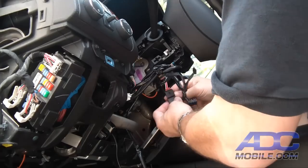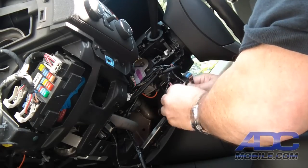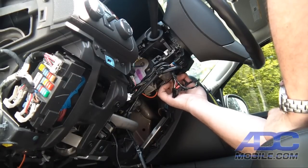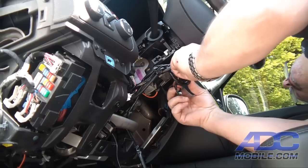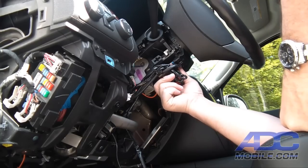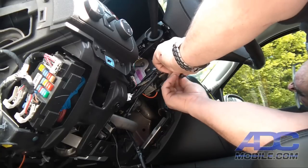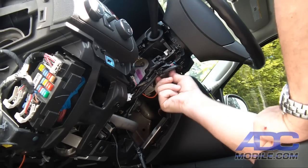Give both connections a tug, and on this one you can snap down the little red retainer so it never comes apart. Now we're left with exactly the same male connectors we had just unplugged. We'll plug those back in on the other side of the column — there's the small one, give it a tug, make sure it's tight — and here's the larger one. Plug that in, snap it in, push in the retainer, and now we can find a home for these cables underneath that area.